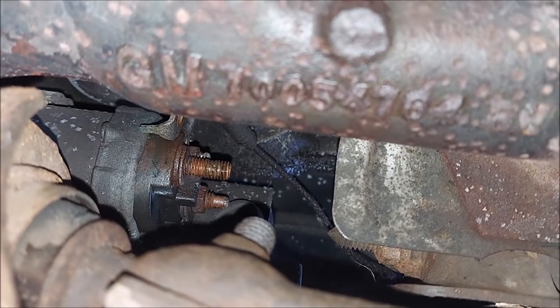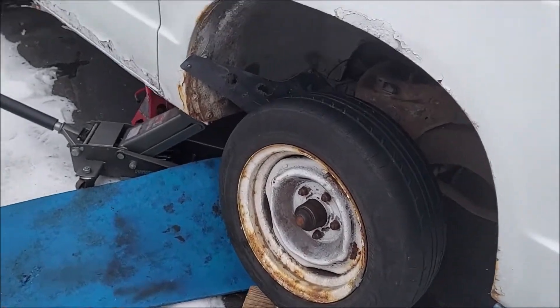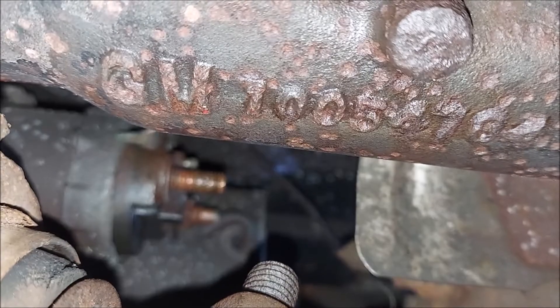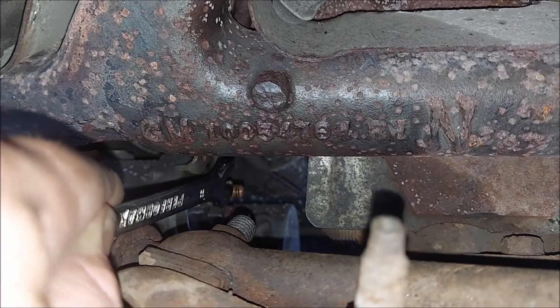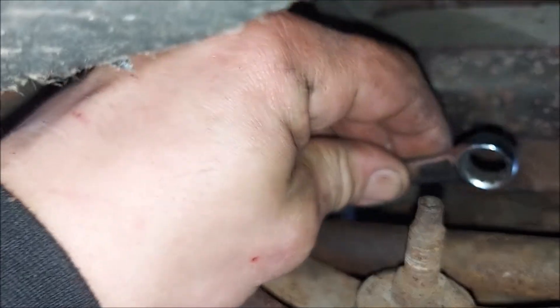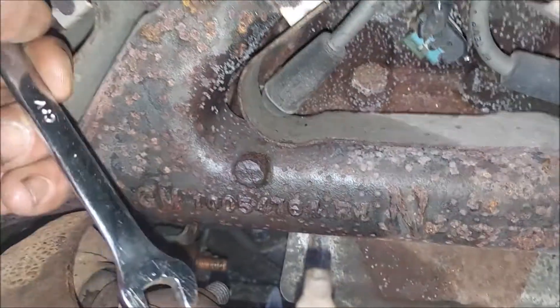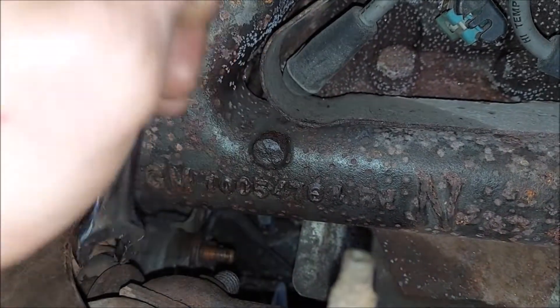I have one cable where there's not a nut right there — I have that removed, and getting it off is a pain. You have to come in through here and get your wrench on there. You can't get a socket in there, so you just have to take your wrench and turn it one little bit at a time, turn it around, and turn it one little bit at a time. When you get to the end, you want to take it — because you have this nub in your way — go right down here and turn it, and it'll be able to do it. I also took a flat head where the nut was and hit down to get it to spin, because you can barely get your finger in there.